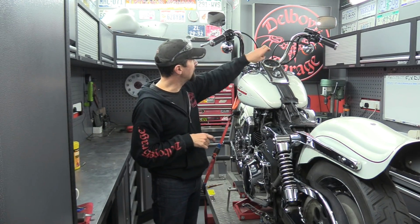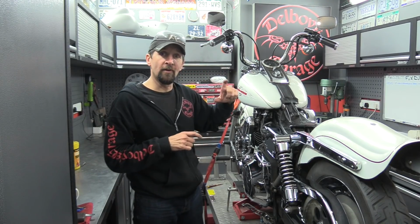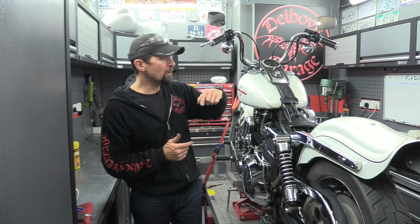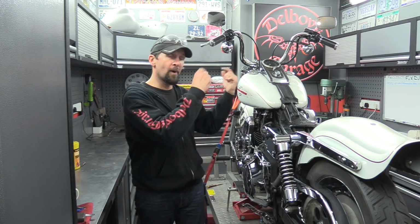So they're going on, and the next video, therefore, I've got to make some risers. Now I've got some really cool Tech Bike Parts 1-inch clamps, which will hold those bars perfectly there. However, they aren't long enough, they're still quite low. I need to make some stanchions for them. I've got some aluminium, I'm going to make some stanchions on the lathe in the next video so I can bolt the T-bars onto this. So join us for that one: bars off, on the lathe, make the stanchions, bolt it all on. I've got to make some trick bolts to hold them as well with a single flat ground in it. So loads of fun fabrication for part 3.